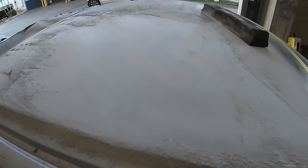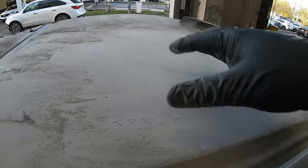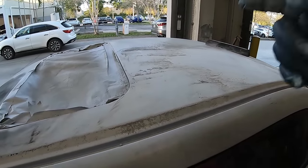After sanding, you can see here that the guide coat is all completely gone, so we know we have a good flat surface. Now that doesn't totally mean we don't have any dents — at the very end we can check it over with some water. So Pedro and I are going to hit the tunes and start sanding on this roof.